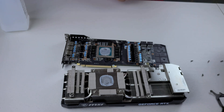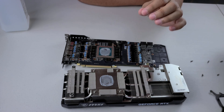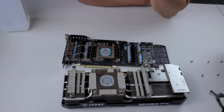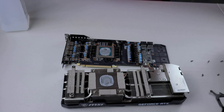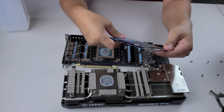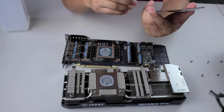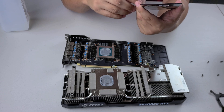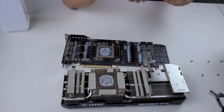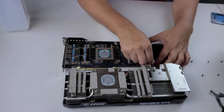So the ones I want to replace are going to be these here — one, two, three, four — with better ones. I bought these online: the Gelid 1.5 millimeter thermal pads. I was watching a video about it and I'll probably link it down below. I've tested so many different ones and that one came out at the top with the best thermals.